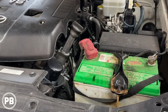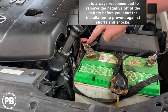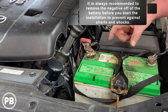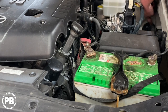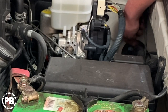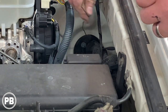Here we are underneath the hood. Our battery is on the driver's side. If we pop this cover off we have a terminal post — that's what we're going to use to connect our power wire to. We want our fuse as close to the battery as possible, so we'll mount it up around here and then run that wire all the way down through our rubber boot here through the firewall. There's a little nipple on the top that's unused — that's a perfect size for our 8-gauge. We'll cut that nipple off.